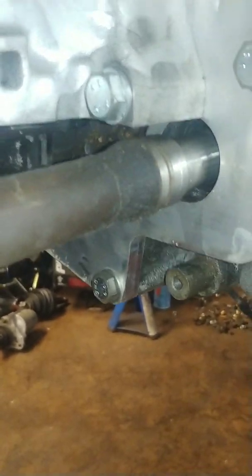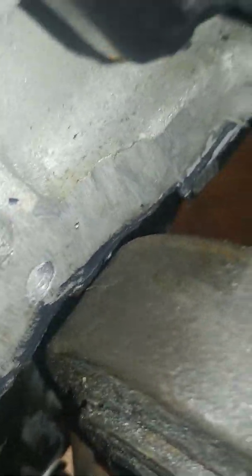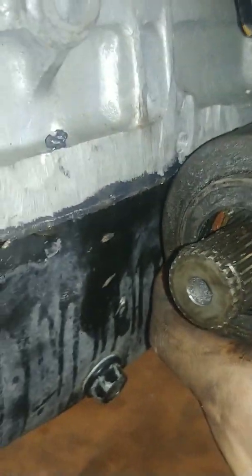So guys, if you put this in here — this is the reason why you need to shave the block. Go to mount this up, it gets in so far and it gets tight. You can see the gap in between it, and that's touching inside. They shaved a decent amount but it wasn't enough — it has to go more, and then we need to accommodate for the axle. We need to shave off some more; I'll get another video once I get the half shaft to fit flush and it won't be touching the block.